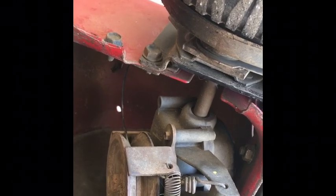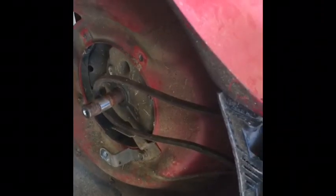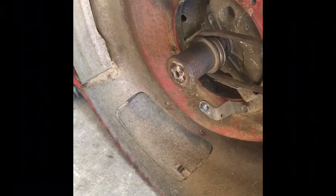If it works, we've got a rear-wheel drive self-propelled mower converted from an all-wheel drive. As you can see, I've got the belt on the rear now. You had to loosen up those two bolts I was talking about and then put them back. Now that I've got the belt on the pulley, I'll tighten it back up — which is actually not that bad. The Toro's personal pace is worse. Let's see if this will work. I did have to stretch the control cable a bit to give me more slack. I did not remove that spring — I try not to remove it if I don't have to. I haven't put back the bolts for the baffle yet, so I'm going to stick this on just to see if it'll fit. I do believe we have a winner.